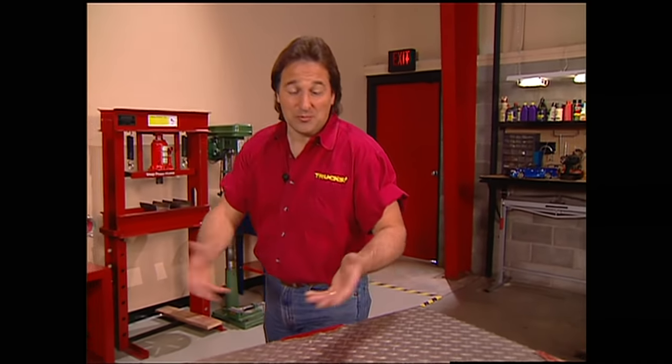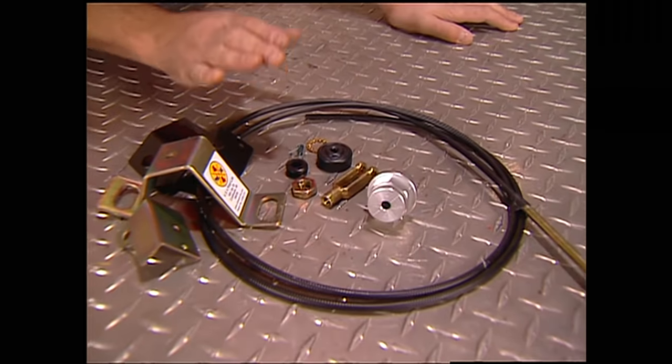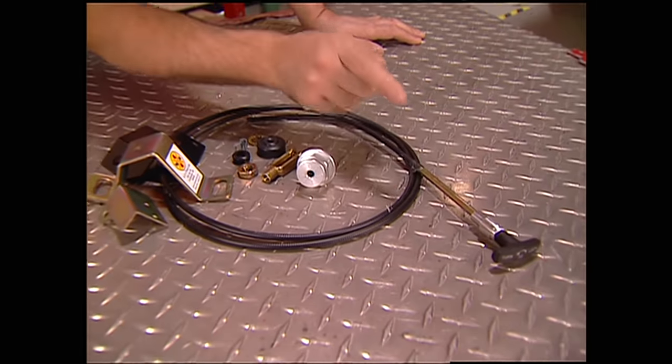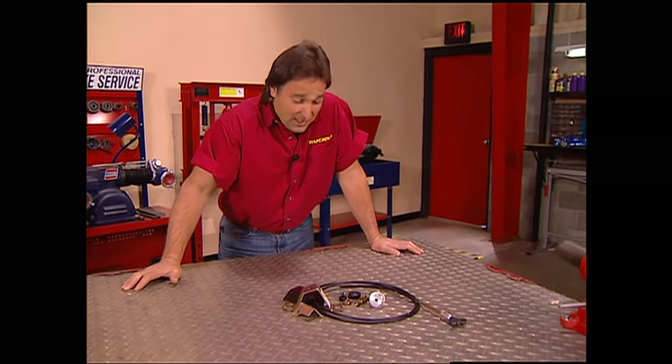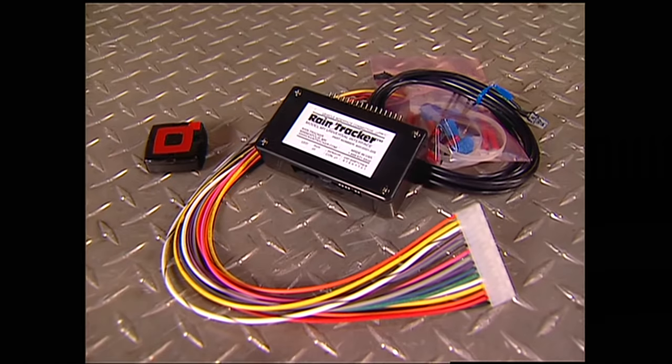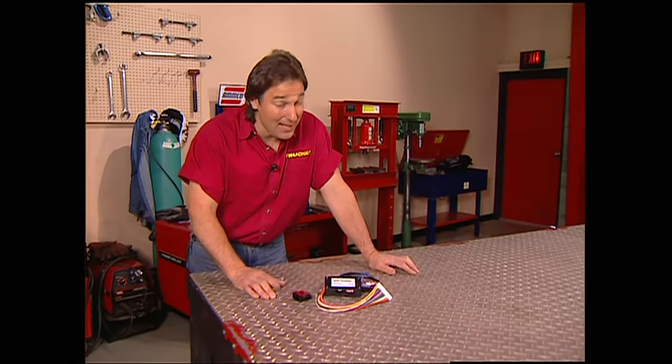You buy a four-wheel drive to have four-wheel drive. If you're driving a late-model Chevy, Dodge, or Jeep, you probably didn't know that the front axle is engaged either with a vacuum actuator or a thermal linear actuator — both of which are notorious for either not engaging when you hit the button or for disengaging when you need that front axle the most. The answer is the 4x4 Posi-Lock, a cable-operated system that completely replaces the stock setup. It allows you to lock that front axle in and it doesn't come disengaged until you decide. This kit installs in just a couple of hours, and the price is around $170 depending on your application. Every once in a while a product comes along where people go, man, what a cool idea — I've got to have one of those.